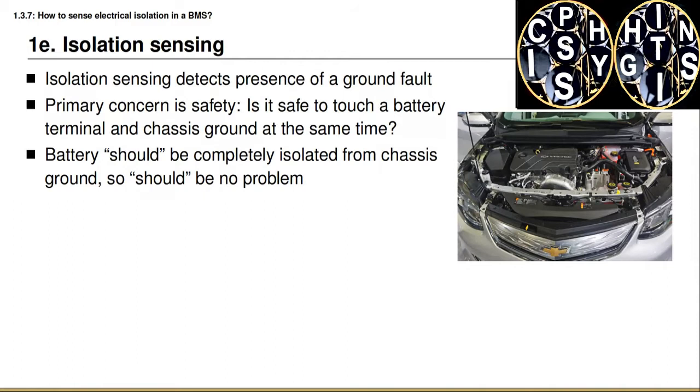Notice that this is quite different from how the 12-volt system is wired in a standard vehicle. In a standard vehicle, the positive terminal from the 12-volt battery is wired independently to everything requiring power, but the ground is wired directly to the chassis. This eliminates the need for running ground wires to every component — it saves wiring and is safe because 12 volts does not have sufficient potential to cause significant injury.